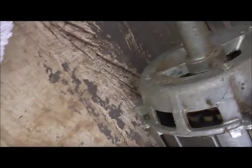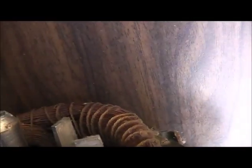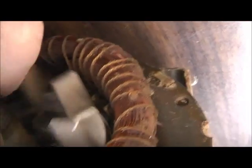Pretty good design. I like how it's designed like this — everything's recyclable, so to speak. Not sure they still make appliances like this. It's a copper pipe sleeve bearing in here — that's not hard to replace, that's easy. You can see what I did with the drill — I missed it a heap of times. When the rotor isn't centred, the magnetic field pulls it and it sticks to the stator, and the motor can't turn. It just sits there humming. It just has to be completely free on all sides to spin.